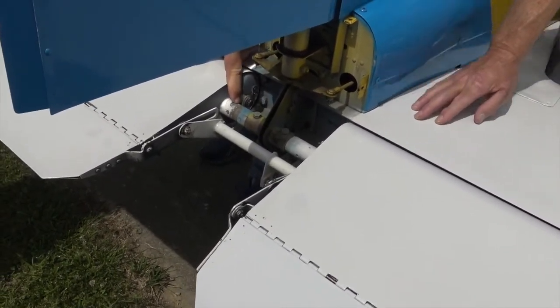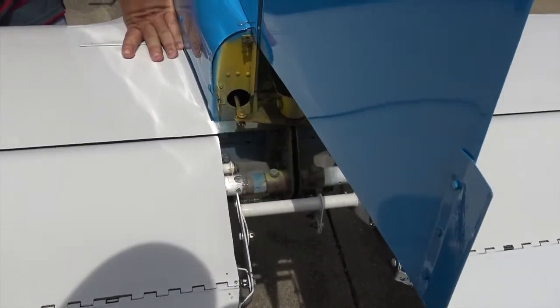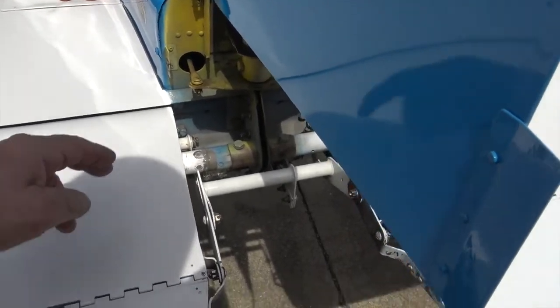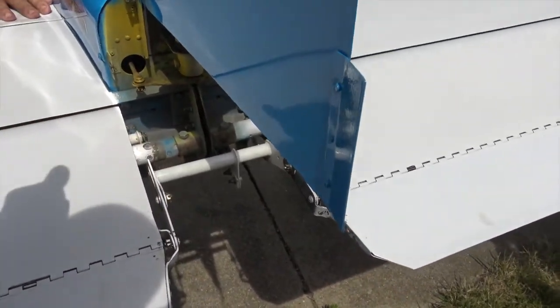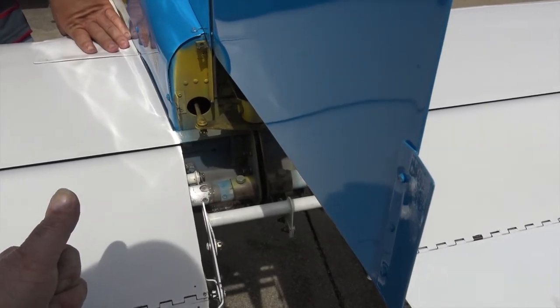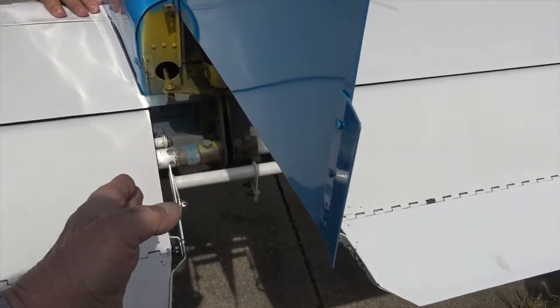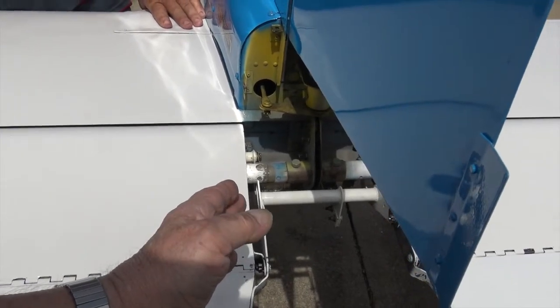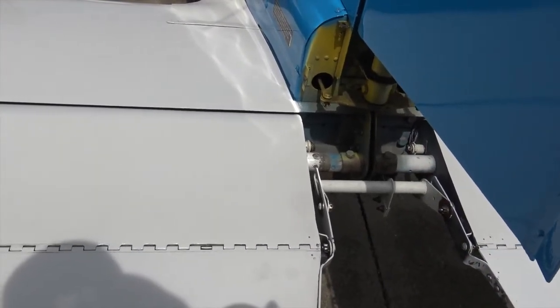This needs to go up to the shop. For right now, probably taking this elevator off and drilling these rivets out. I don't know whether Roscoe's got them, but put the next size oversized rivet in them. But this needs to be bonded and riveted, and that's actually not a legal repair right there. That should have a 337 done on it. Technically it should have field approval. Or replace the elevator.